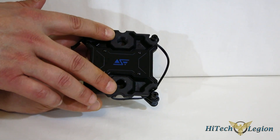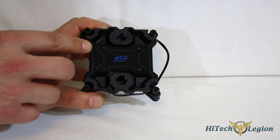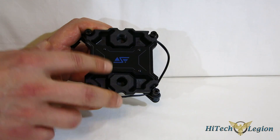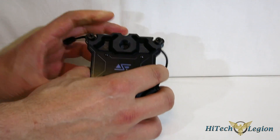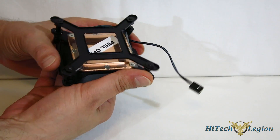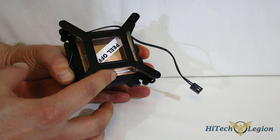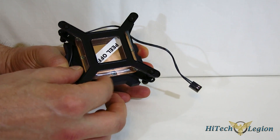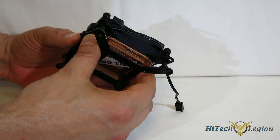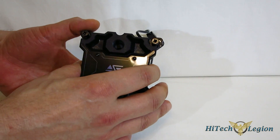The G1/4 connectors are spaced enough so you can use up to a 3/4-inch fitting without a problem. Something to keep in mind if you are going to be changing colors: if you are using a larger fitting, it's going to block the plate — you're not going to be able to change it while it's in your case with fittings on it, so you have to change out the color before you put the fittings on. It comes with the Intel 1155 mounting kit already on it. Also includes AMD AM2, AM3, FM1, FM2 kits, as well as an Intel 2011 kit. For those wanting to use a 775 or 1366 Intel kit, you do have to purchase a separate backplate directly from SwiftTech. It comes with a very, very simple install kit — the same one we've seen SwiftTech using on products for a while now. Very simple, very effective, very easy to use.